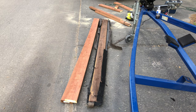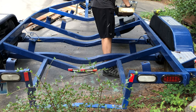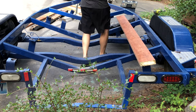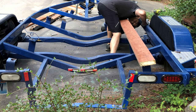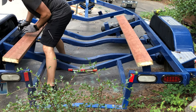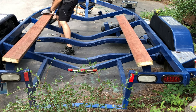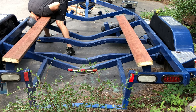Here's a look at our new piece of wood against the old worn-out piece. We'll carry it over to the trailer, lay it down, and center your metal brackets — it might take some adjusting. Make sure you have enough overlap at the end of that board for the carpet to wrap around it. Once you get it right where it needs to be, take a sharpie marker and trace the hole so we can come back with a drill bit and drill it out. Also mark front and rear or left and right on top of the board so you don't forget which side should be up.